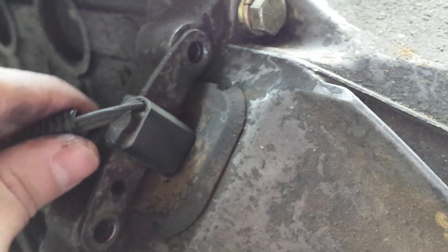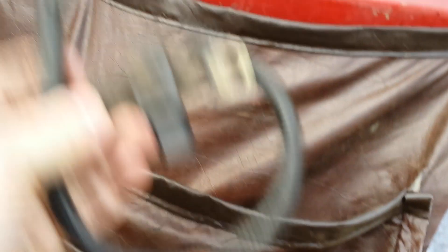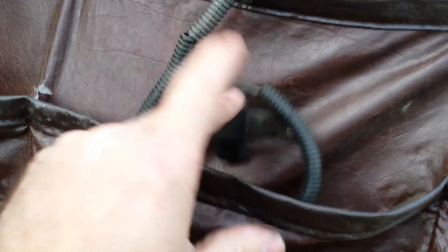A quick tip: carry a spare crankshaft position sensor with you. I keep an extra one tested and tucked in a pocket in the Jeep. If you're out somewhere and suddenly it quits firing and you diagnose a bad sensor, you've got one on hand. The crankshaft and camshaft position sensors are the two main ones to carry spares of — other sensors like temperature or air temperature sensors just throw a code; these will leave you stranded.